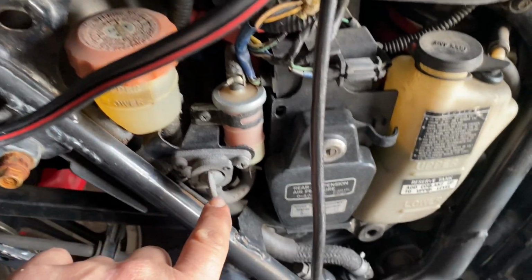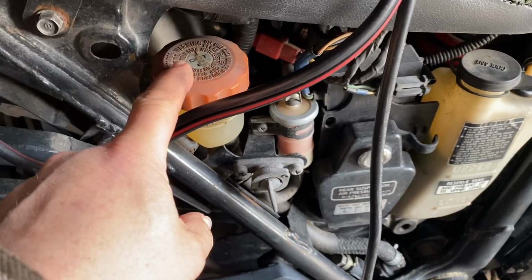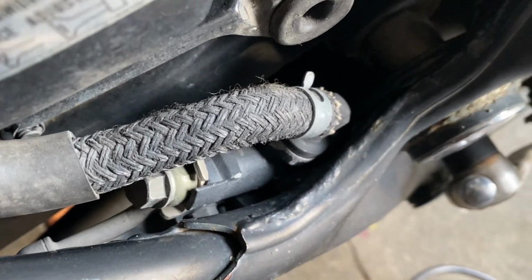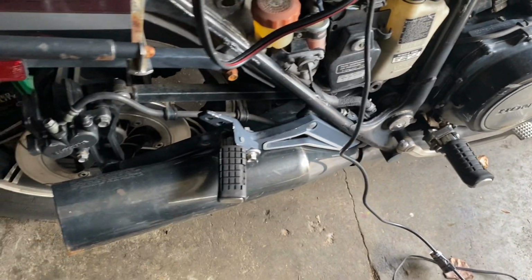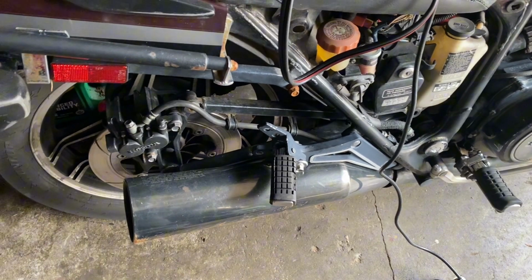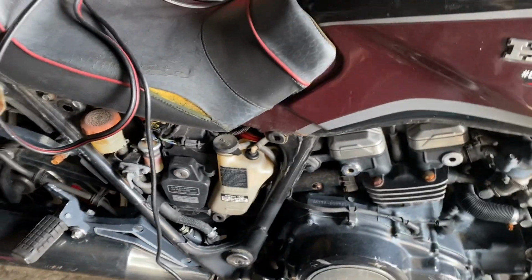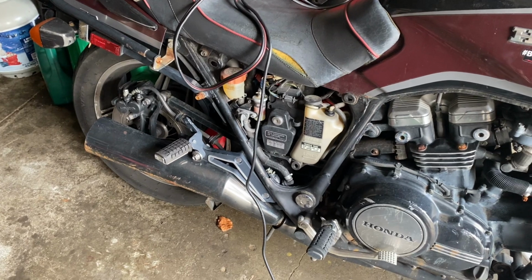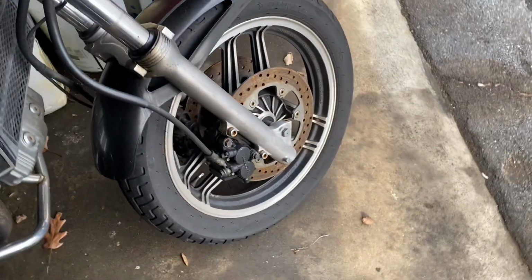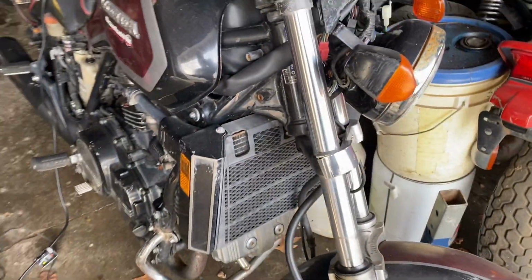Well, on the rear, that's somehow buried down in this piston, because that's where your piston has to return. And this is just a reservoir. I already tried cleaning that out and it's free, goes the whole way down through. But we're gonna have to take this piston out and clean it and make sure that's clean. Then this should function as well as it ever did. The rear has already been taken apart, new seals and new fluid. So we're gonna lose some brake fluid in the process, but that needs to be done. I think it doesn't grab, but it just doesn't return to resting position the way I think it should. I don't love the way these brakes are because they're just meant to kind of hover, but that's how they're designed, so that's what we have to deal with.